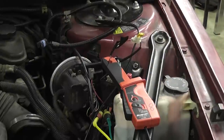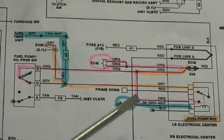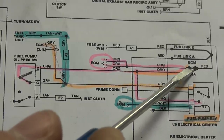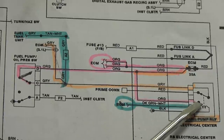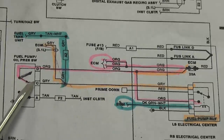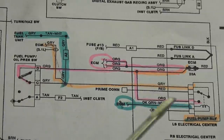Here's the wiring diagram for this car. The fuse that keeps blowing feeds two wires on the ECM, powering it up. It also comes down through a splice to the load side of the fuel pump relay, and feeds through to the fuel pump oil pressure switch. This switch is a bypass in case the relay fails — that's why GM ran an oil pressure switch in parallel. It was not intended to shut the car off if you had low oil pressure; it's there as a backup.